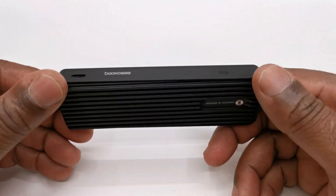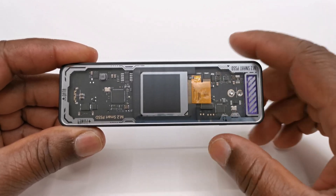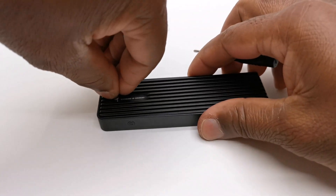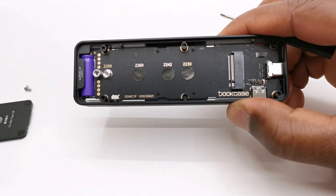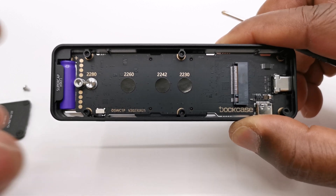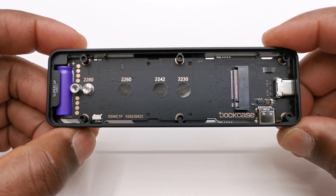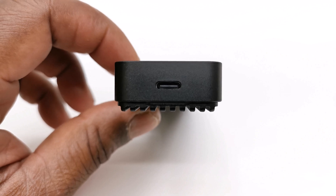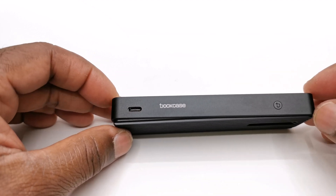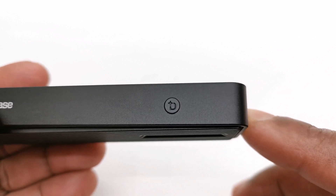The design of this enclosure is part aluminum, which acts as its heatsink, and the surface consists of tempered glass with an LCD health monitoring screen behind it — the first of its kind. The back panel is secured by one screw and opens up to gain access to the M.2 NVMe slot. It has a USB Type-C data port and can facilitate 2230, 2242, 2260, and 2280 SSD sizes. It's compatible with M key NVMe type with speeds up to 10 Gbps and B and M SATA key types with speeds up to 6 Gbps. The top edge has a 10 Gbps USB Type-C data port, and to the side has a 15W USB Type-C power delivery port with a power requirement of 5V 3A. The final feature is a button to navigate the menu on the LCD screen.